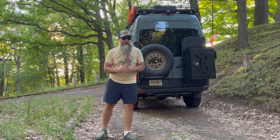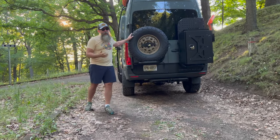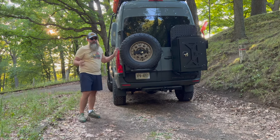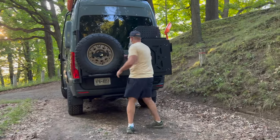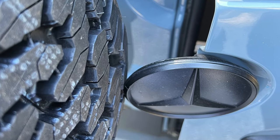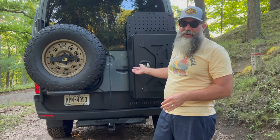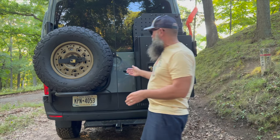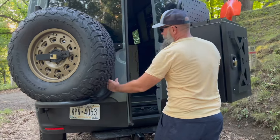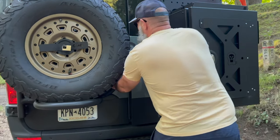A couple of things on the back. Number one, we have the Owl Vans tire carrier on the back. One issue when you get to this size tire is you're not going to be able to run your stock emblem — you'll see I had to remove it. You can close the doors with it on, however you can only open them from the inside once you do that. To close it, you'd open both doors and push them together at the same time to get the emblem to work in there, then close one and close the other.